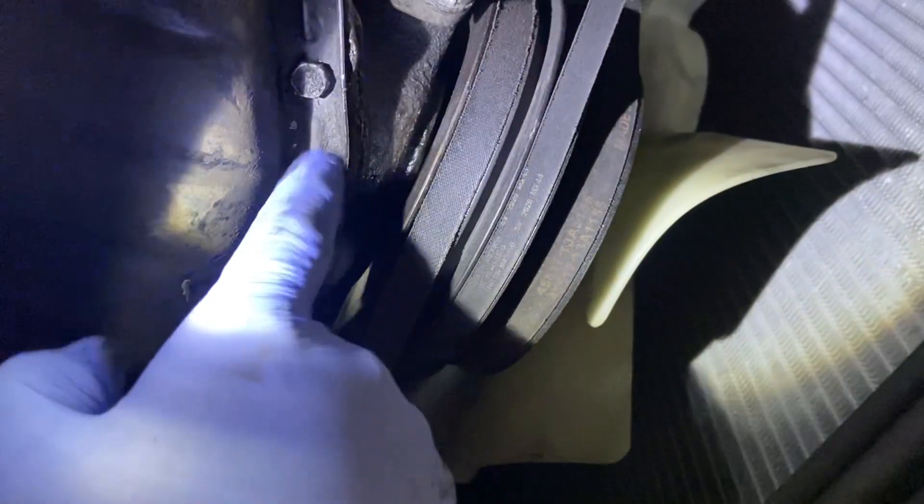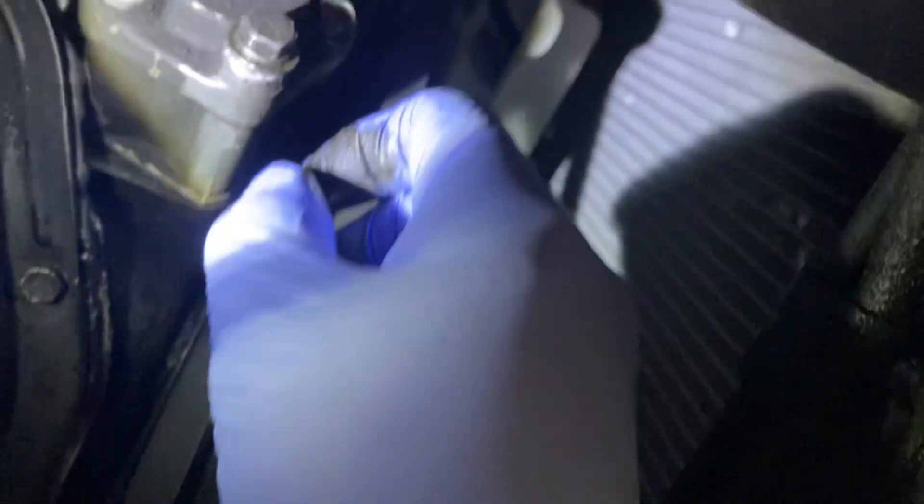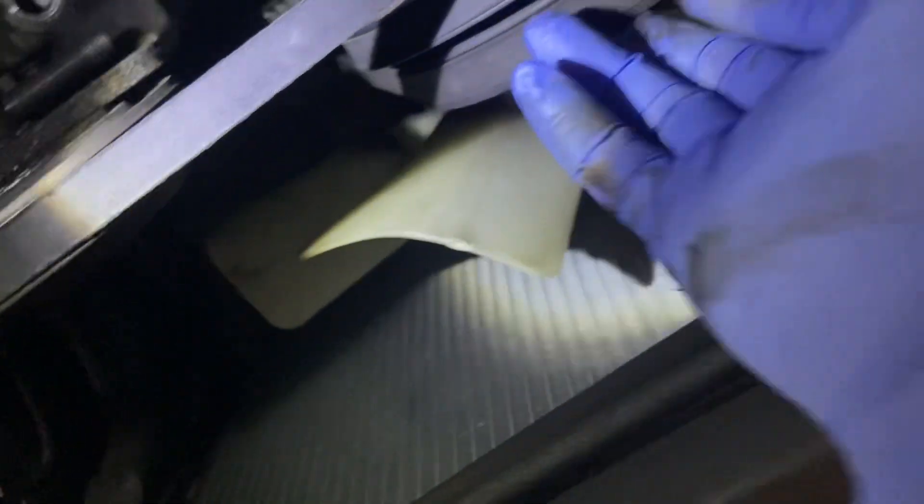Let's see if this is fresh. Does it look to be a hole? I gotta monitor this here. It does look real fresh, but I need to spray that up here by the crankshaft with some engine degreaser, and then clean that off with water. I also need to spray more here.